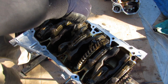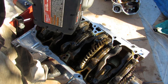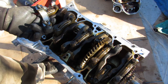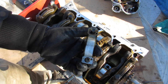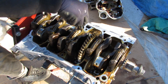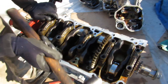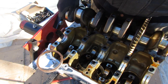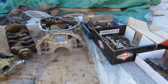I'll break these 12-point 12mm connecting rod cap bolts free — they seem to be tight. Looking at the bearings, none of them look too bad, all four seem fine. I'll push the pistons down so we can remove them out the bottom. Loosening the 14mm main bearing bolts, we have the rear main seal at the back. With everything else free I can lift out the crankshaft and drop out the pistons.